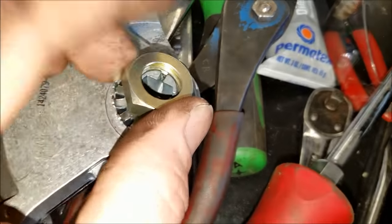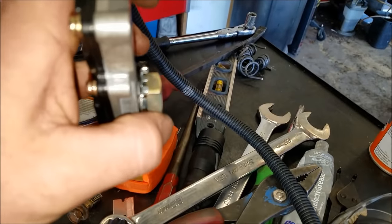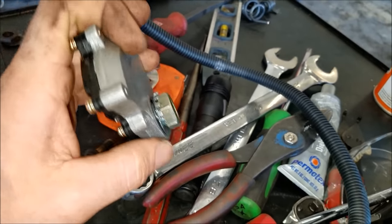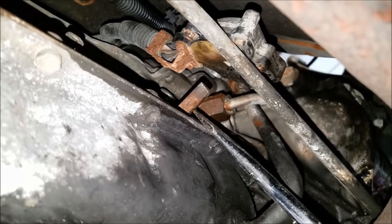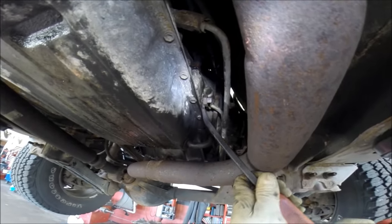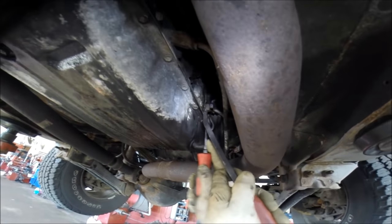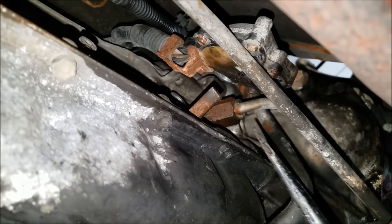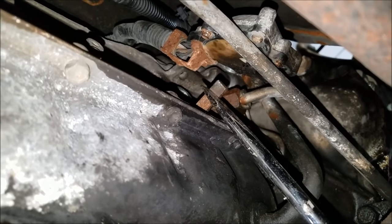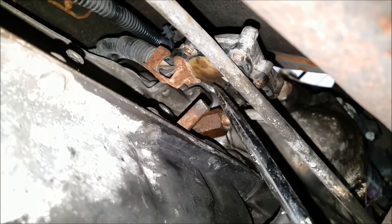Basically, once you've sprayed this down, thread the nut back on about partway, and then put a screwdriver or two behind it. Come in with another block of wood or wrench beneath the screwdriver and actually pry it off just like that by the nut. Get one screwdriver here, one over here — maybe even have a buddy help you. If you have a good amount of rust penetrant on there, maybe even apply a little heat with a mini butane torch, and you should be able to slide this off the shaft.